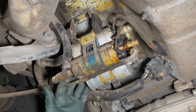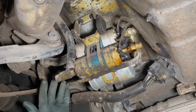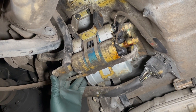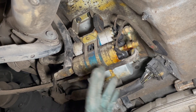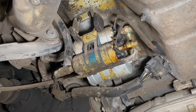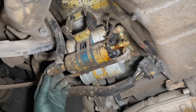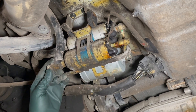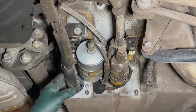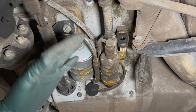You're looking at the fuel delivery system on a 1991 500 SEL — this is a W140 chassis with LH Jetronic. If you look closely, you're thinking this looks very similar to what was on the 126s and the R107s: it has two fuel pumps, it has a filter. But there's a significant difference — can you spot it? That's right, there's no accumulator.